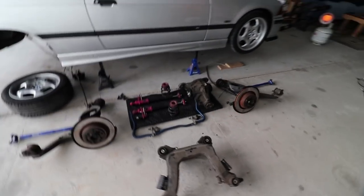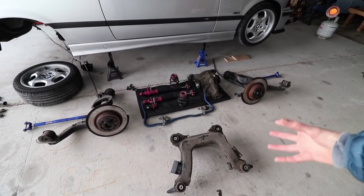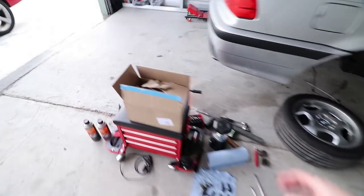What's up guys, welcome to another cold wet day here in Utah. I could not have picked a better time to start working on all this stuff, to have the car up on the jack stands for three weeks or so, because for the past two weeks it's been rainy, snowy, and cold. Today we're going to move on to part two — cleaning all this stuff up, getting the old bushings out, preparing it for paint, and getting the new bushings in, plus the reinforcement plates welded on to the rear of the subframe. I did get some car parts in, so let's go over those.